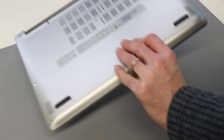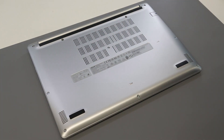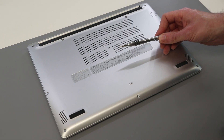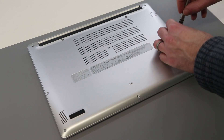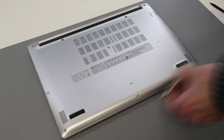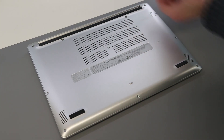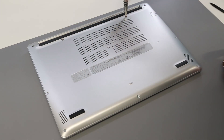I'm going to start by just turning it over to see the base of the laptop. The tools we need are a small Philips — size zero — screwdriver and a plastic pry tool. We are going to start by going around the base and removing the visible screws.